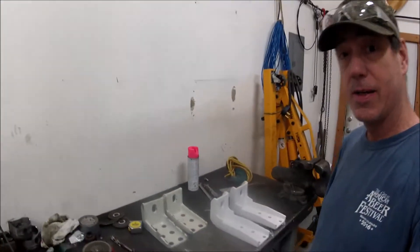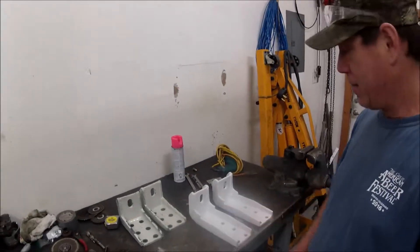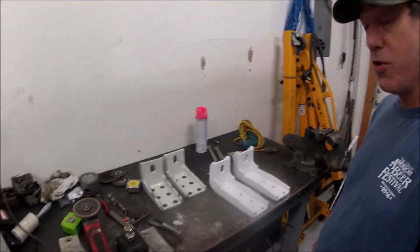I built some motor mounts and using the modified hoist there — that's working out really nice. I was able to put the engine in with an overhead crane. When I got it in the shop here, I can lift the motor with that hoist. Got some motor mounts built here. Had to make them a little taller than the original ones.